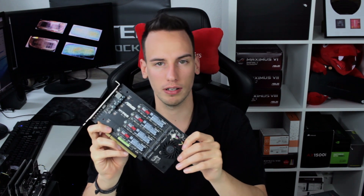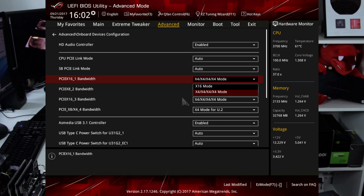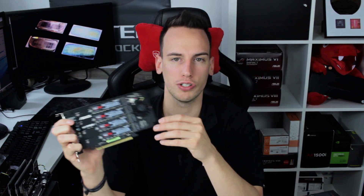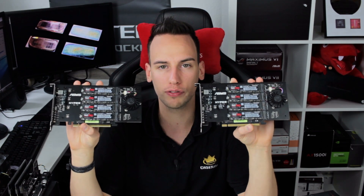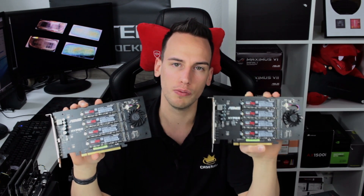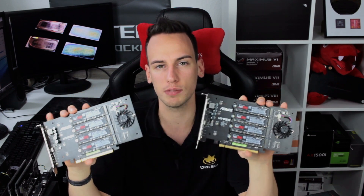The Hyper card will be available soon in retail stores, but keep in mind it won't work on every board or with every BIOS — you have to tell the CPU how the slot is configured. You need to go into the BIOS and split the PCIe slot into 4x4x4x4 mode. The Zenith Extreme has a new BIOS for this; go to onboard device configuration, set the desired 16x slot to 4444, and also set the PCIe slots to RAID mode. For our test we configure two 16x slots to 4444 for both Hyper cards, giving us 8 NVMe drives total.